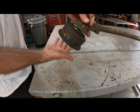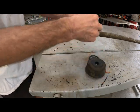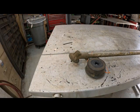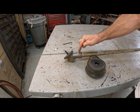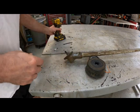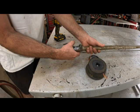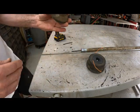Look at that. Hang on to it. Now, flip it over. You've got one little set screw in this FS56RC. You get your Torx 27. Give it a loosen. You might have to take a little screwdriver and spread that just so gently. But this is, yep, that's gonna come off pretty easy. And that's all there is to it. Let's see what we got here.